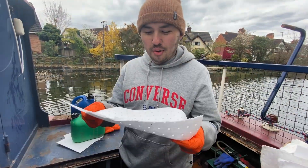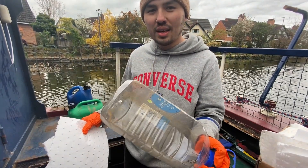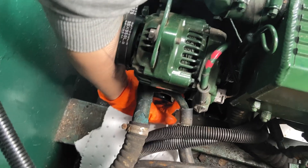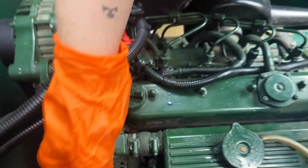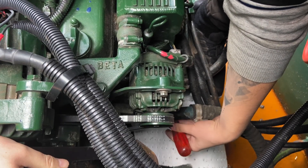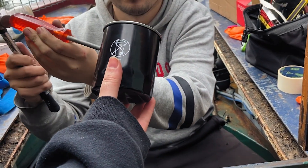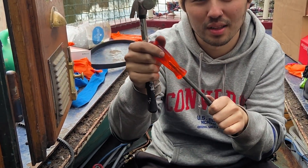Now it's time to get the oil filter off. I'm going to put a pad underneath it — there's still probably going to be some drippage when I take the filter out. So I'm going to take it out and put it straight in a bag so that it's not leaking everywhere. If you can do it by hand that's great, but a lot of filters can get very tight, so you may need a belt wrench or an oil filter adapter. However, if you don't have access to any of those, there is a last resort method using a screwdriver — though you can't then reuse the filter. Grab a long screwdriver and hammer it all the way through the filter, make sure it comes out the other side, and then use that as a handle to unscrew the filter.